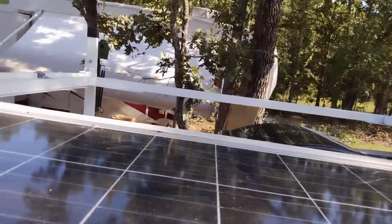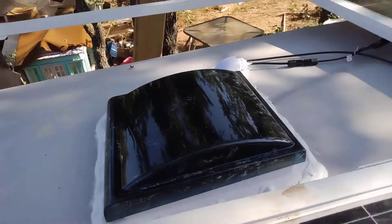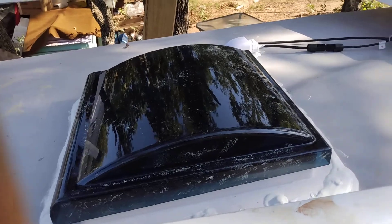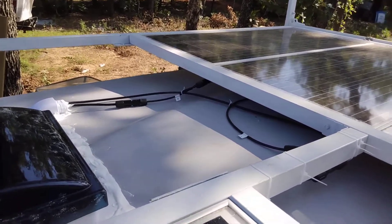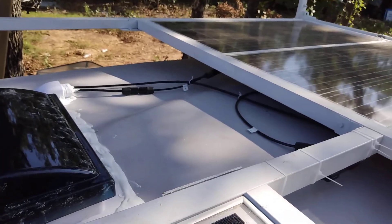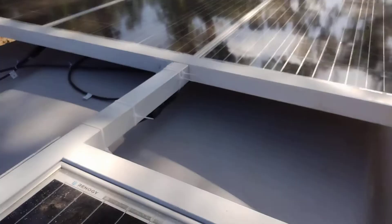Sorry, I'm making you seasick. There's the roof vent from the top — the static cling has got a little dust on it — and there's the roof gland. I dicored it all in and it's got putty tape underneath the edges, just like all the videos show. I zip tied everything. I have some Eternabond tape and I don't know where I set it, so I got to find it so I can tape those wires down. I don't want them slapping against the roof going down the road.